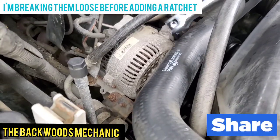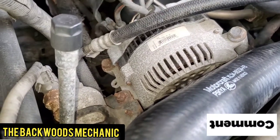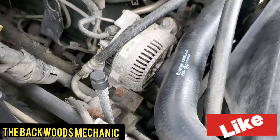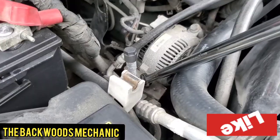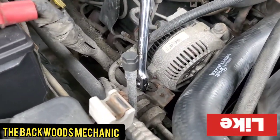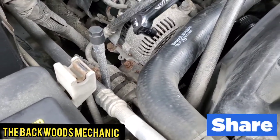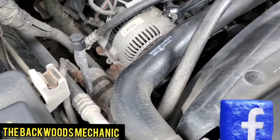In order to get to the bottom when you have this hose in the way, you're going to have to move this out of the way to get to it, which involves taking this fastener loose first. We've exchanged sockets - I've got a 13mm on the end of my breaker bar here. It gives me some nice long reach and I can easily turn it and break that fastener loose. Once that's broke loose, I can put a regular socket ratchet on there and run that off. Then I'll take the 15mm and break the second fastener loose as well.